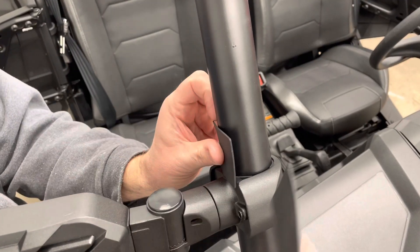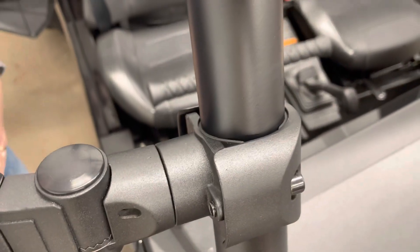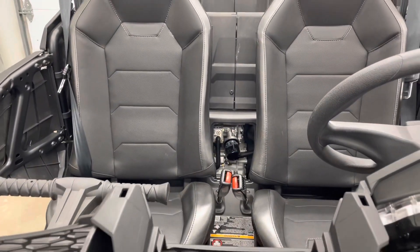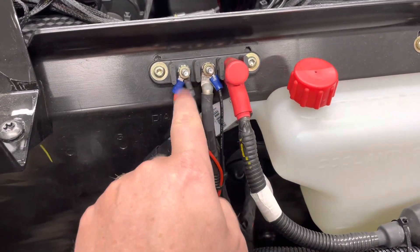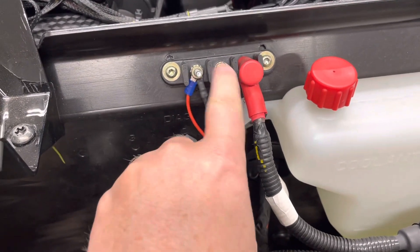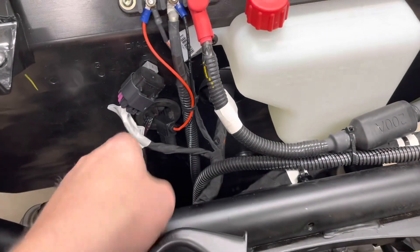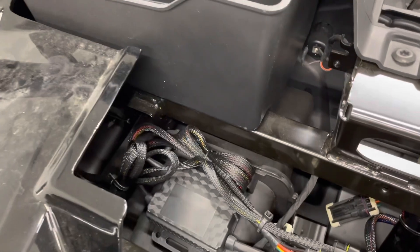For the side arm to mount onto the cage, they provide these rubber pieces — the smaller piece goes behind the outside part of the bracket, and the bigger piece goes on the inside. You can see we've already put those rubber pieces in, and those are what grip to the roll cage. To install this kit, we removed the hood, the dash cover, the cubby, the cover down there, and also the engine cover in the bed. We chose to hook up the power wires for the kit right here, replacing the loops that came with the kit with smaller loops that go over these posts. This is where we chose to mount the horn on this factory bolt.